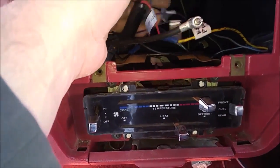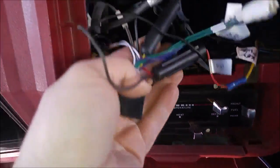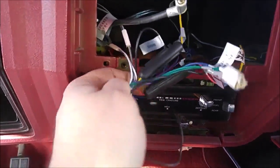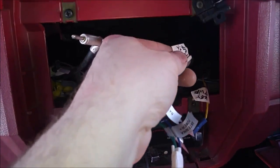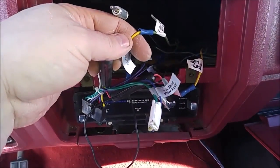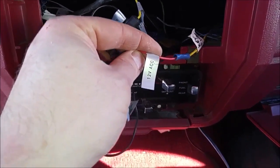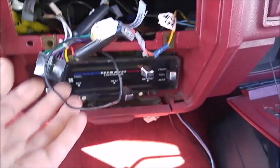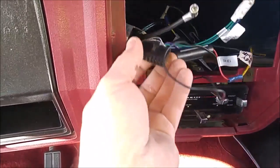So basically all these other wires that are in here, they go to my speakers. They're all the other wires on this harness. Here's my harness. All harnesses can be a little different. For instance, my battery wire is my constant power there. So that just is a direct constant power. It goes from yellow to green, and similar to this one, my key power is a red wire on my harness. It goes to my key power. How I knew that is going off of the info that's provided with my stereo system and harness.